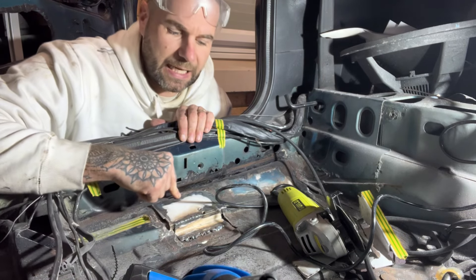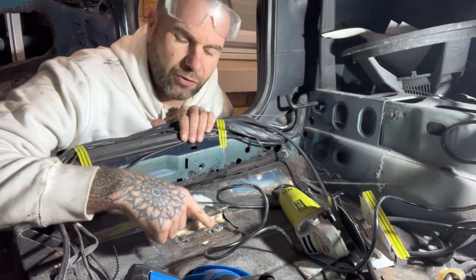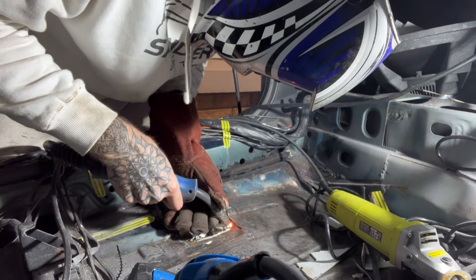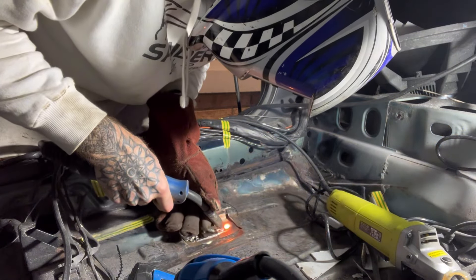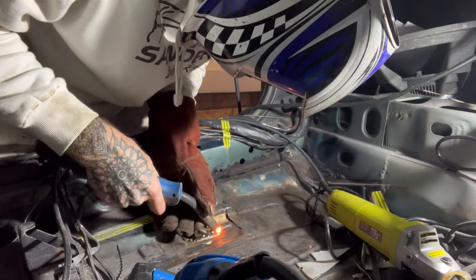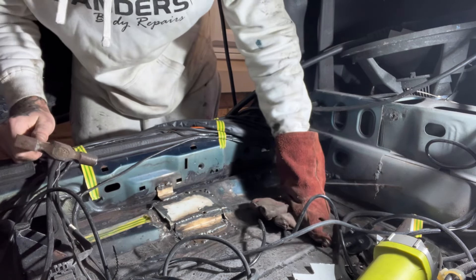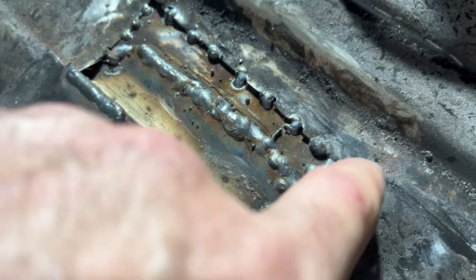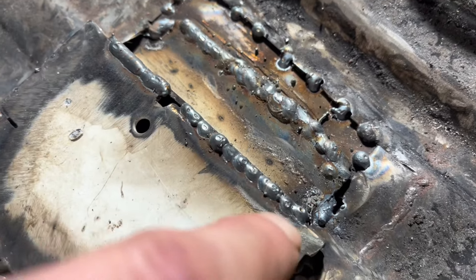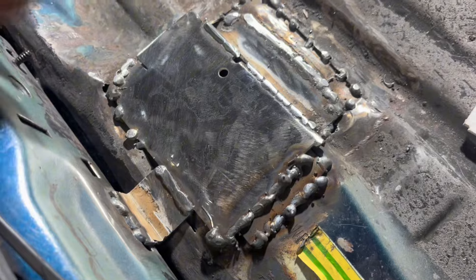You would have seen on the last video that it's got welded in, but I started to run out of gas. So that's really hammered hell out of that. It's not welded down here yet, but where I've gone to weld this in now I'll grind that back first of all and then re-weld it from scratch with some fresh gas. And it's absolutely solid. So as I told you, I spotted that floor skin out before and it was already welded underneath - nice and thick, solid, and penetrated. You can see the heat through there. It was painted, and we've got this nice bead on here and an additional right angle here. I'm going to grind that back now.